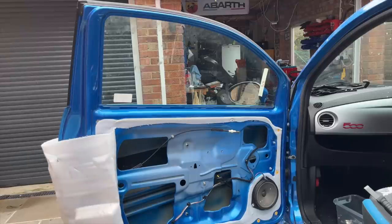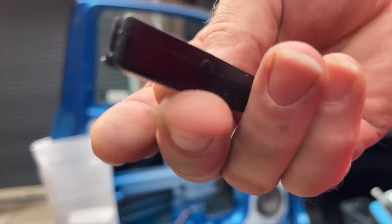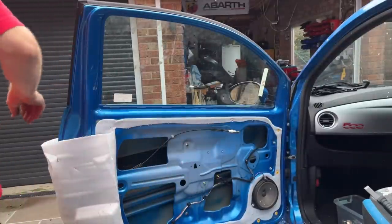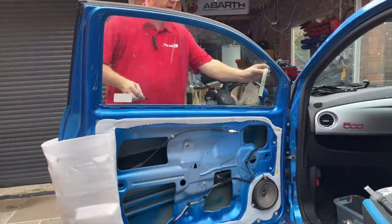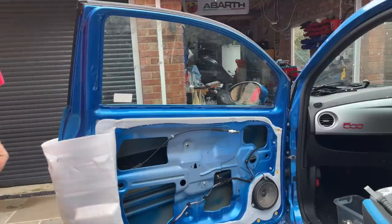So that is actually the first time I've successfully done a window. I'm really pleased about that. So Mark at Resurrect, if you haven't done yours — I think you probably have because I think you've sold the car now. So let me show you the little plastic bit. It sits on the edge of the glass and goes into the runner from underneath, which then keeps it in the channel. And by keeping it in the channel it doesn't tip forward. So I'm really pleased about that.